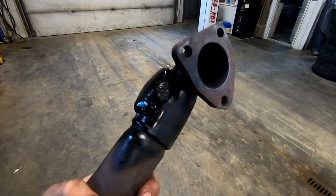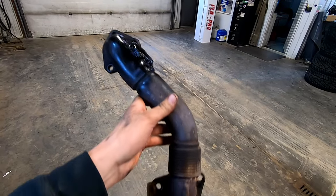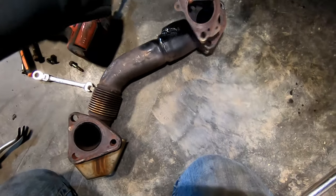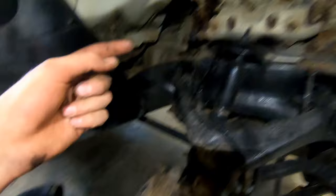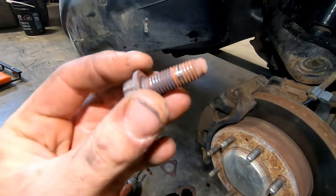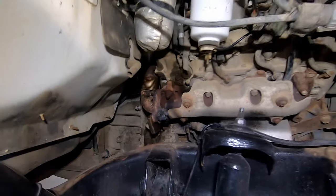Here is the finished product — doesn't look super clean, but it'll get the job done and it saves the guy a bunch of money because these pipes are stupid expensive when you buy them in a kit. Now we're going to put this up pipe back on the truck. You can reuse the gaskets and as long as your bolts came out nice you should be fine. If they stripped some threads, get a tap and tap the holes in the turbo or exhaust manifold. I always use copper coat on the threads of these bolts when putting them back together so they won't seize up. Up pipe is back installed.